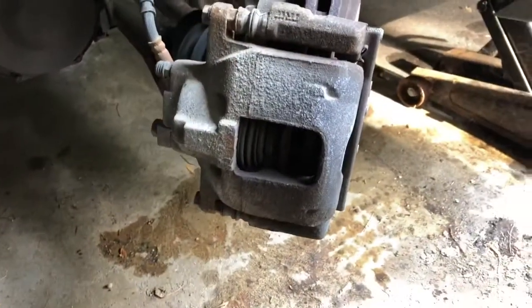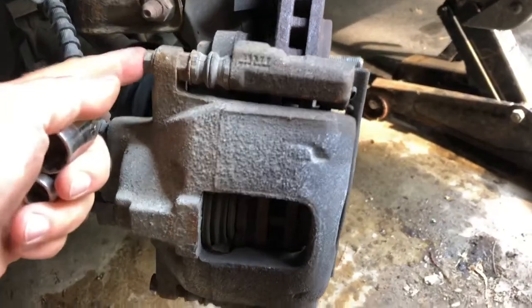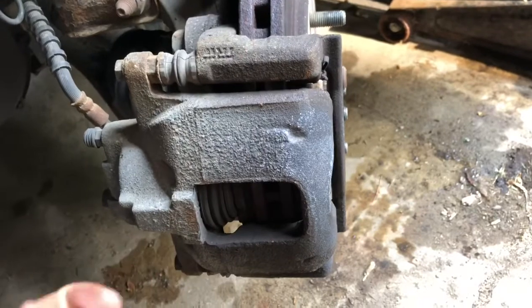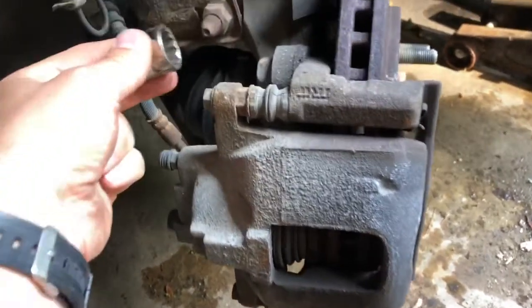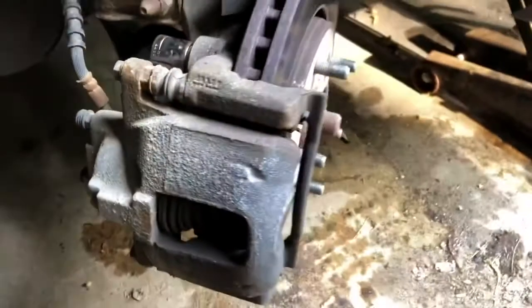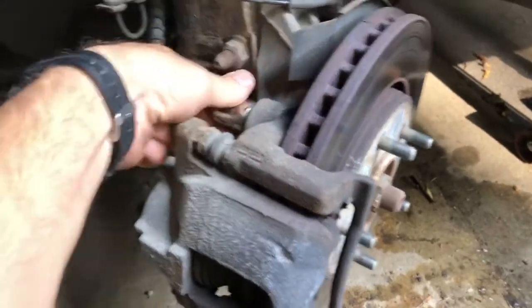Here's what we have looking at it straight on. Going off my memory, I believe I only need to remove these half-inch bolts here and here that hold the caliper pins in place — that should loosen up this caliper assembly and I can get the brake pads out. There's a 13/16ths back here and one down below that may have to come off as well, but I think that's only if I'm gonna do the rotor and need to get the bracket off.